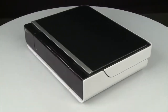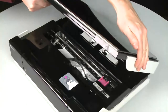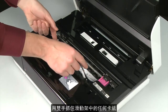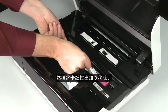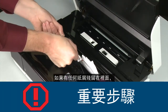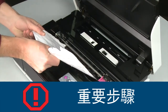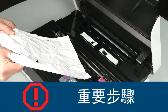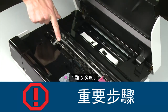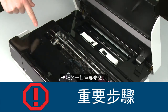Return to the front and open the access door. Grasp any jammed paper in the cartridge access area with both hands and then pull it up and out to remove it. Remove the paper as carefully as possible — if any torn pieces remain inside, more paper jams are likely to occur. Small pieces of paper can easily stick in places that are difficult to see, so thoroughly search left and right inside the printer. Searching the carriage path is an important step in preventing future jams.